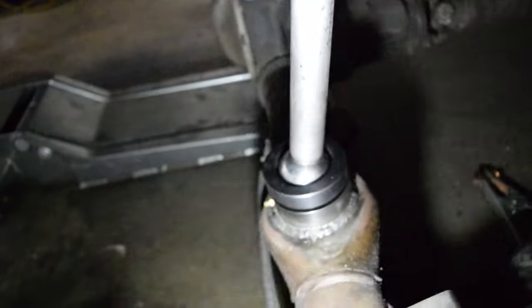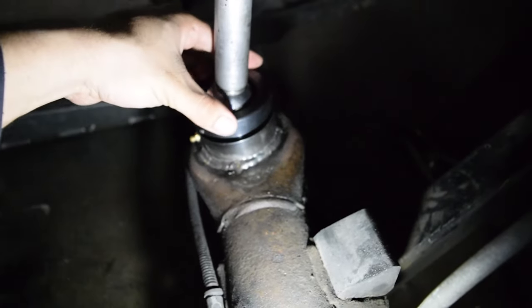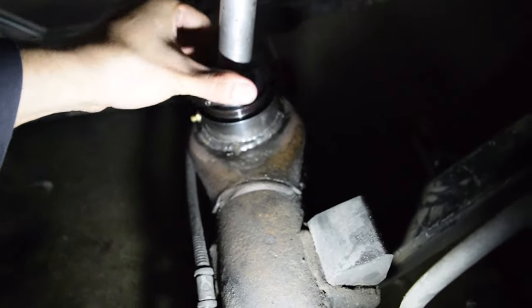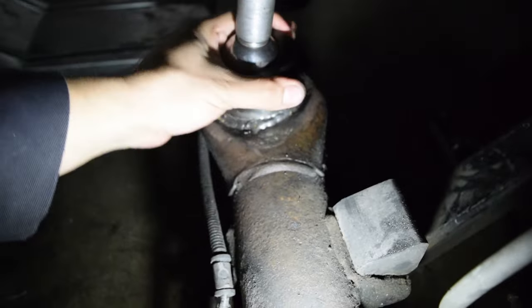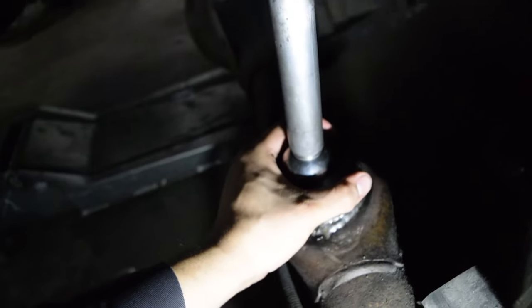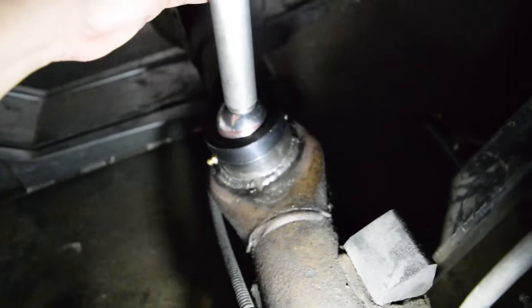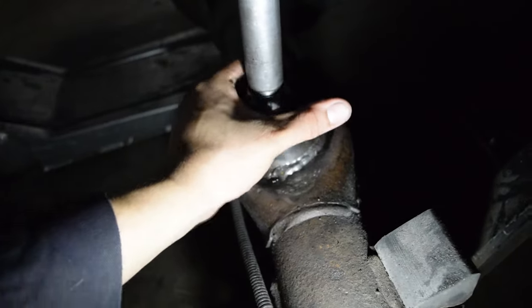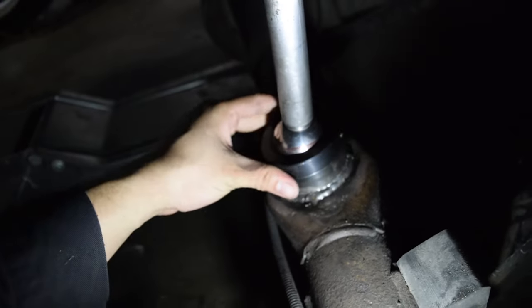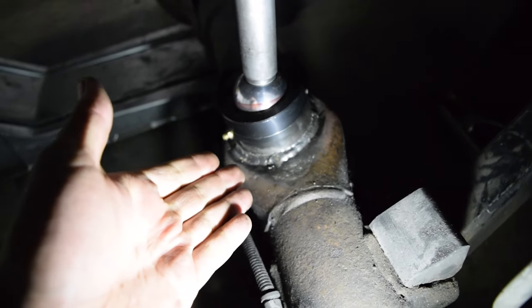We're now sitting in our power ball. Let's set this up and begin the threading process. Oh yeah, there we go. I don't know exactly how tight these are supposed to go but she's gonna give her all she's got. There it is boys — basically complete. You can see we got a little bit of grease on our power ball; as we cycle the suspension up and down it'll grease itself. I'll grab these with the channel lock and give them a nice decent tightening, then hit the set screw on the side and this side should be good, aside from a little bit of paint.